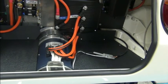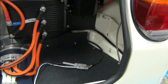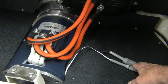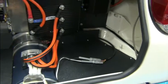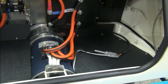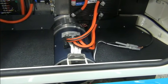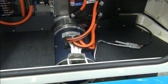What we're going to do next is remove these panels — the side panels come out very quickly and easily. We'll disconnect the encoder lines, remove the wiring harness from the controller, disconnect the three cables going into the motor, then pull the motor out and put it out of the way. We'll get the motor for this build out of the box, install the coupler, the adapter, the flywheel, the clutch, and put it back inside.